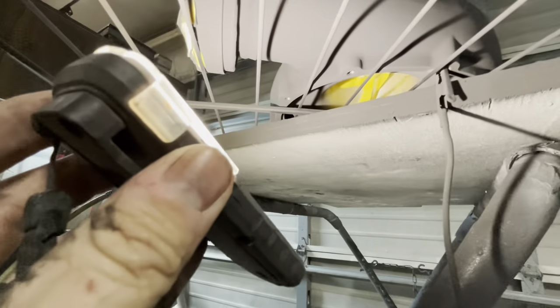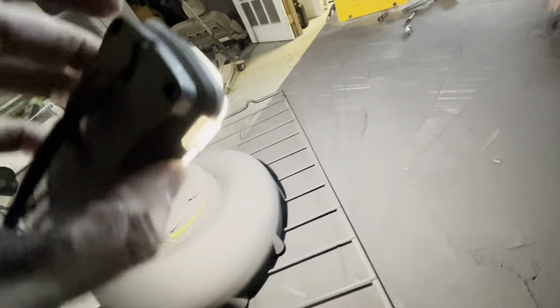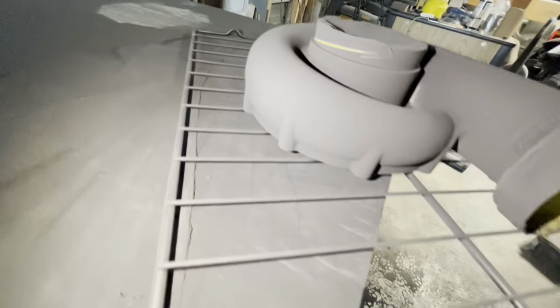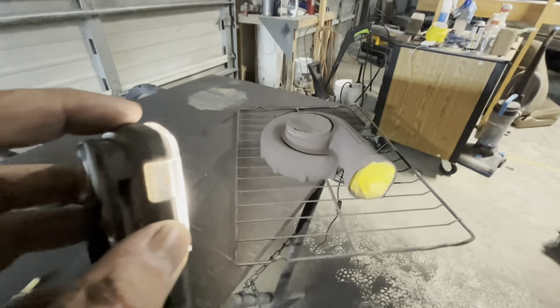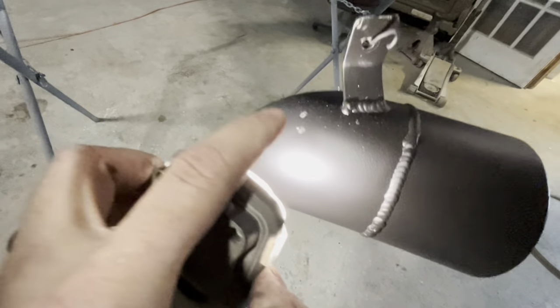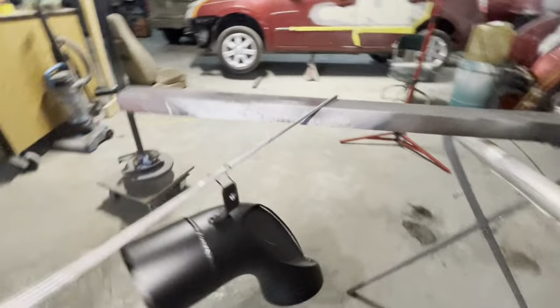I've got a feeling it's to do with something on the actual ProCharger that probably needed to be removed. I got that side done — we're definitely going to take a razor blade and clean that backside up where it bolts up, make sure we don't have anything in our threads. I'm curious to see if this one just turns out textured like hammered or if it develops actual fish eyes. But everything else on this one I'm digging — it looks good for a DIY Harbor Freight powder coat job, in my opinion.